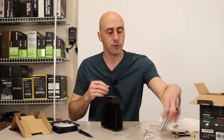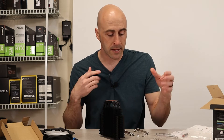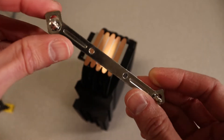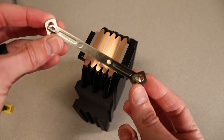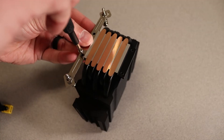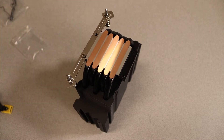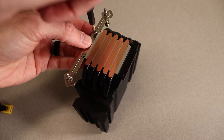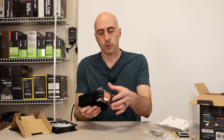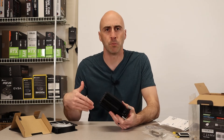Let's throw this together and see how easy it is to assemble. All you need is a Phillips number two screwdriver. Grab your screws and the mounting brackets you'll need — for AMD you reuse the original backplates, for Intel you'll use the included backplate bracket. The brackets angle inward for proper pressure distribution. You run two screws in from underneath to hold the brackets down. The screws that go into the AMD motherboard backplate are just spring-loaded retention screws. Put the same thing on the other side and your brackets are all set up, ready to install onto the motherboard.